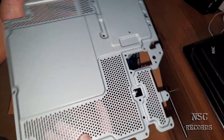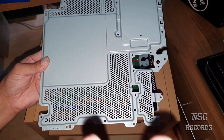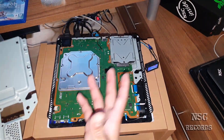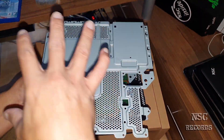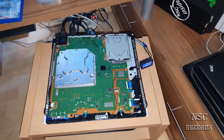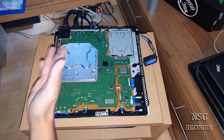I still have the original PlayStation 4 Pro package - I'll just put these back because I don't need them anymore. The only thing you need to know - this plate is good for stability. When your PlayStation falls down, it could be critical because your motherboard might break faster or the case could bend faster. So you need to take care because this normally is really good for structural integrity. If you have this included, of course it will not bend as fast. And of course, don't let your PlayStation fall down when you have liquid metal thermal paste, because the liquid metal could run everywhere and cause a short circuit.